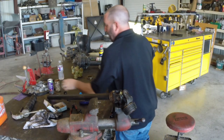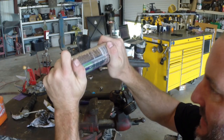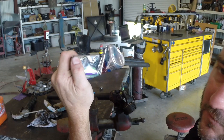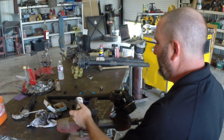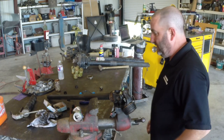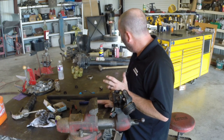To show you how dents in the drive shaft cause issues — a dent in the drive shaft causes what's called a stress riser. I've got this can — we'll pretend this is a drive shaft. This drive shaft can hold a lot of torque, but if I put a dent in it, that's a stress riser, and now it just wads right up. If you see a customer that's got a dent in their drive shaft, it's not stupid to replace it — it could leave them stranded pretty quickly, and when you twist a drive shaft up like that it gets real expensive real fast.